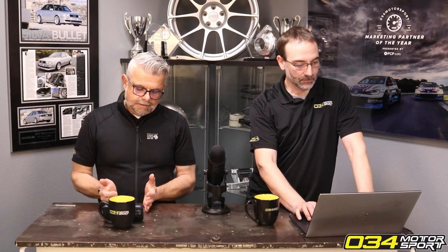But I will say there's some truth to a slightly different version of that. E80 or E85 or E75 isn't necessarily safer than, say, E60 or E65, because it has less fuel system capacity the higher the E content is. So it could be, and I'm just guessing, but I want to address it, that maybe that got somehow interpreted into E80 isn't as safe.